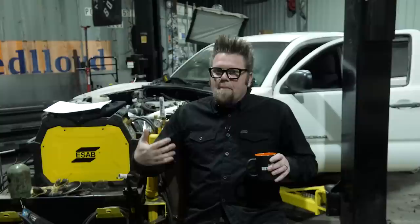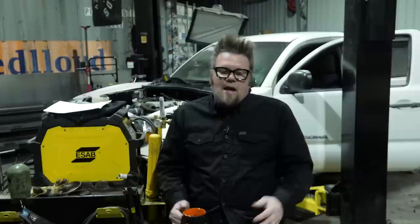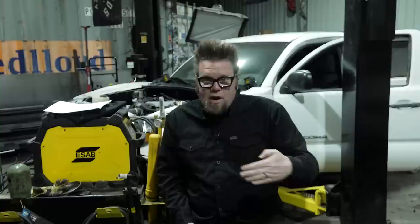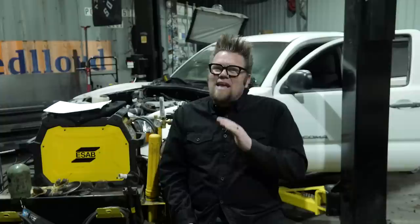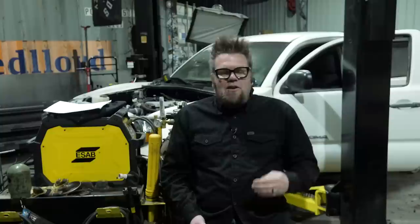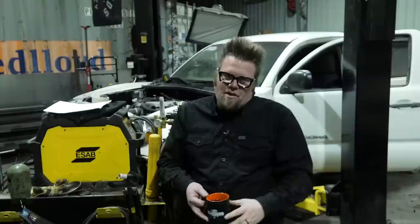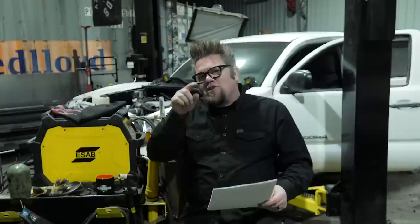I cut the rear of the frame off because I was adding a Savvy Off-Road rear bumper with a new rear cross member, which raises the bumper and improves departure angle. That made it much easier to fit the TJ tank. I used the original cross member for the springs and shocks, modified the TJ tank mount, and built mounts for the back of the tank. It's a 16-gallon tank — perfect for my R2.8 diesel. Carries enough fuel for a full day on trail and back to Moab. Yes, it can be done, but it's application-specific.